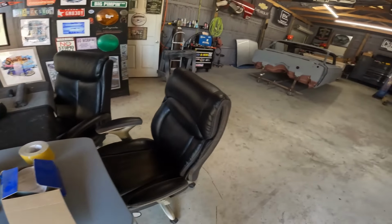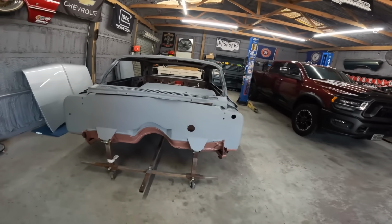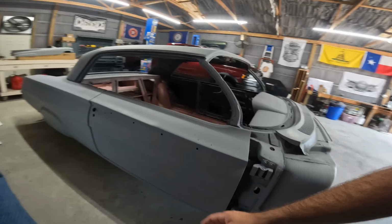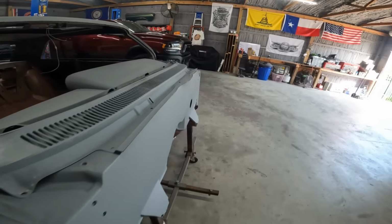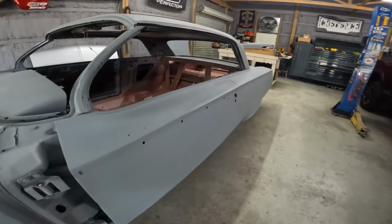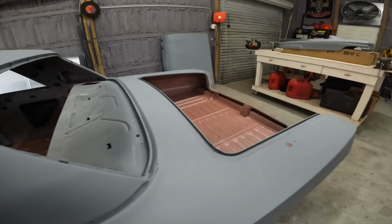The reason why we're going to start with 400 is because some areas, if you guys remember, especially the doors, when I sprayed the primer, the gun was acting up and it sprayed really bad, so it's really rough. So we're going to cut it with 400 first, maybe 320, just to get the heavy stuff off, re-guide coat, and finish in 600. The rest of it is pretty good, pretty much 2K primer.